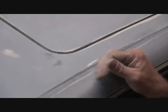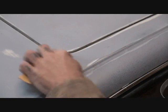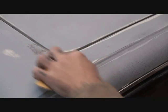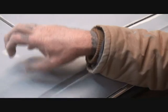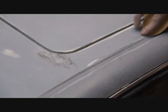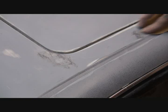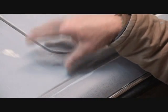So what I'm gonna do to fix that dent, I'm gonna take me a piece of 80 grit, I folded it in half, and I'm gonna rough my area up just like so. Okay? And I see there wasn't no filler applied to that. Now, I did DA80 this whole roof, so this has been very, very coarse sanded, so it will grip. So anyway, I go ahead and rough that up. I come over here, if you can see my finger, and I'm roughing that up to put some Bondo on it. Okay, there we go. Now, since we are putting this on primer and this will be our final coat of filler, I just happen to have some right here ready to go.